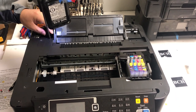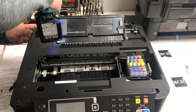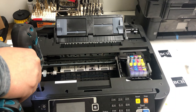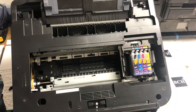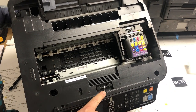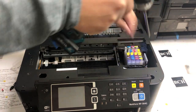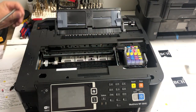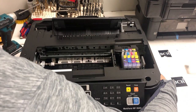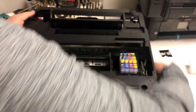The second screw is underneath the hinge. Three is inside that hole. Four is on the top. Five — there are two screws — five is the bottom one, not the top one. Six is on the top again and seven is in the hole. Do not try to remove the cover until you make sure you have all seven screws. Now you can see the cover is really loose. Use your hand to go around and lift it little by little and it's going to come off.